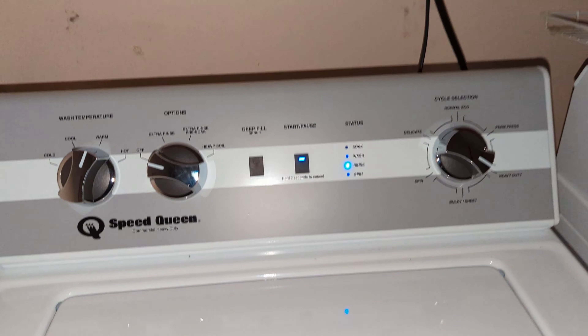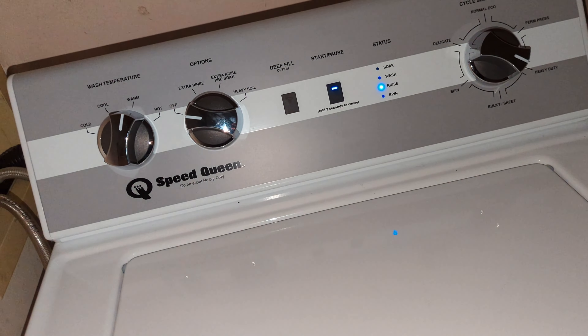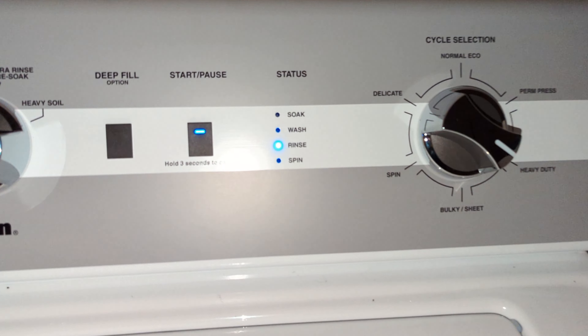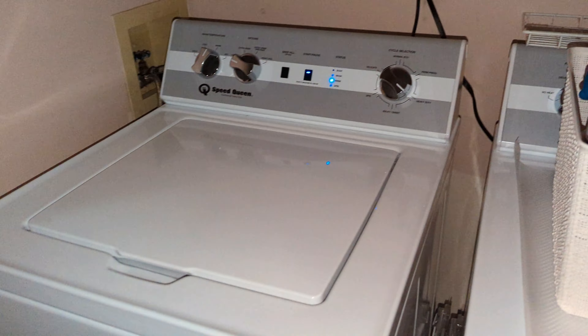It is filling with cold water now. It's not even on the cold setting, but all rinses are cold. Now it's going to start agitating again. So you got to see that the cold water was not working, and my grandma was afraid it ruined her clothes because the water was set to warm. Warm water is not supposed to steam heavily at all, so it was very unusual. There's no squeaking sound — usually some older Speed Queen 2-3-5s would make a squeaking noise, but that's not the case here.